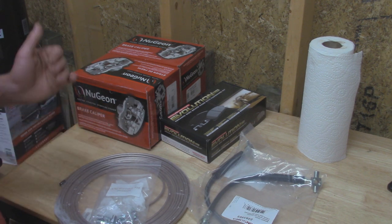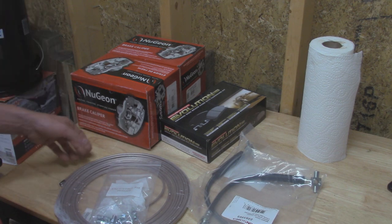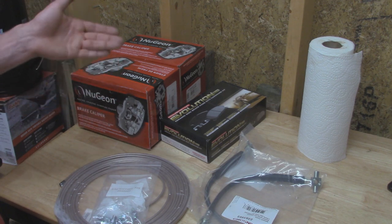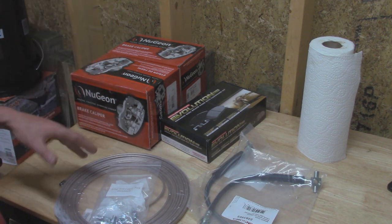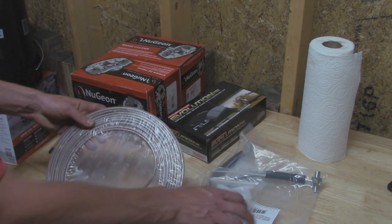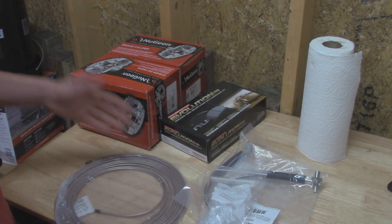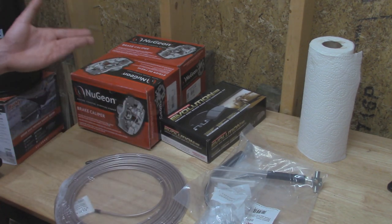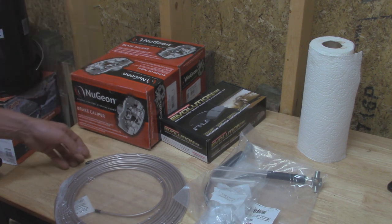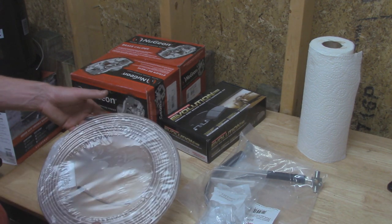Something that's kind of interesting is when I did the rear brake line on my red Jeep Cherokee XJ over the winter, I used copper nickel brake line as well, but I used it from a different brand. And what I've noticed with weathering so far, it's actually starting to corrode, and it's actually a different color brake line than this. You can actually see this is kind of silvery because it has that nickel in there, and I think the brand that I got before must have just been pure copper, because it's starting to corrode a little bit and starting to get green, kind of like how copper does when it's weathered. So I'll leave a link in the description below and we can find this. This seems to be good quality, and hopefully it should last with the elements.